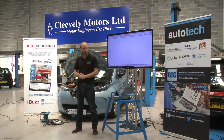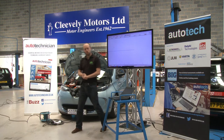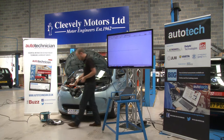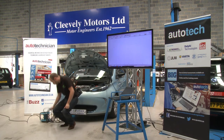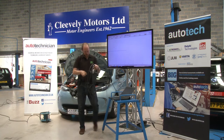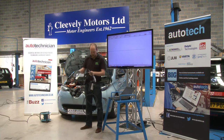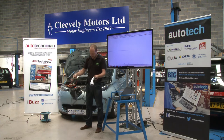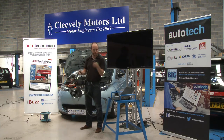Hello, I'm Peter Melville from Hebra and today we're going to be talking about the way the vehicle communicates with the charging equipment. If we take one of these, most people will probably identify this as a charger for an electric vehicle, and you're not really correct, because the charger is actually in the vehicle and it's carried around all the time. The technical term for this is the supply equipment.